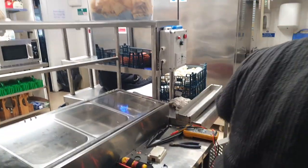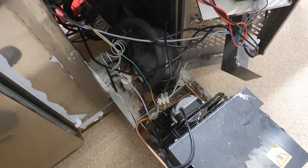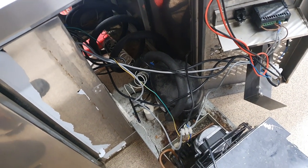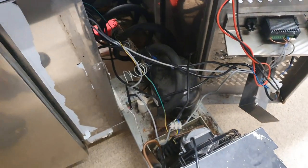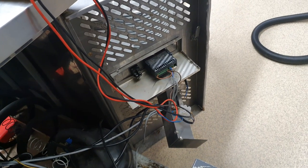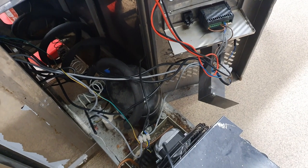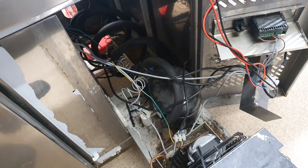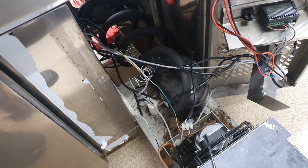Further investigation required — the compressor wasn't turning on, the fan wasn't turning on. I must have just caught it because it was still five degrees and everything is still down at temperature. So I'm assuming we've formed an ice block of some sort, and that ice block maintained temp overnight. We've pulled out the verge and other bits, and we're going to look into it. This particular model has always been given as a bit of a problem. There was no supply going through to the compressor, so I've slid it out. Fortunately this system is on a sliding tray with big coils of copper pipe so you're not putting any stress on the coolant lines.